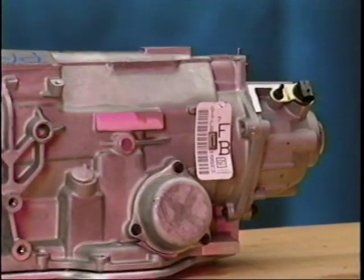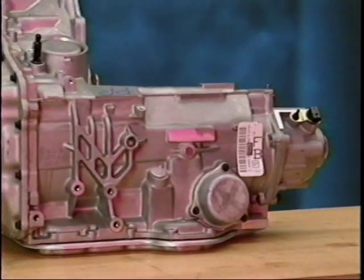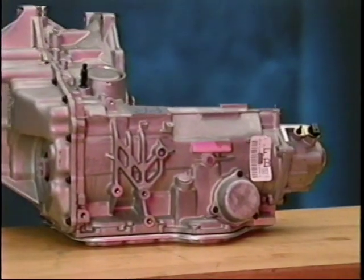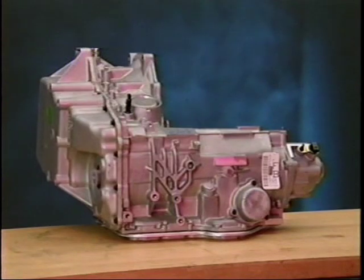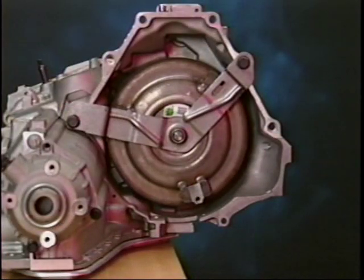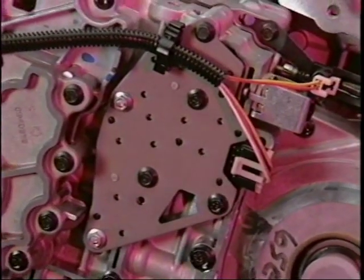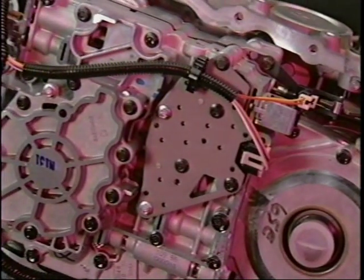Both the Park Avenue and Ultra feature a new 4T65E electronically controlled 4-speed automatic transaxle. This unit provides increased torque and smoother shifts through precise pressure control. The 4T65E has a larger torque converter and enhanced electronic controls aimed at improved smoothness, quiet, efficiency, and performance. The electronically controlled capacity clutch monitors the slip rate of the torque converter clutch.